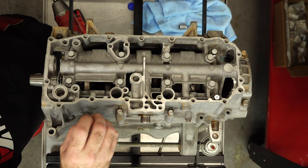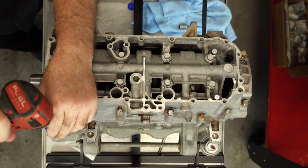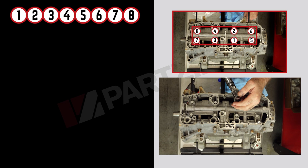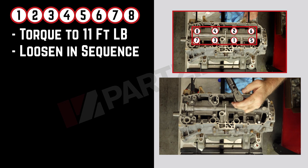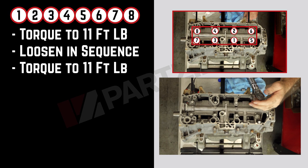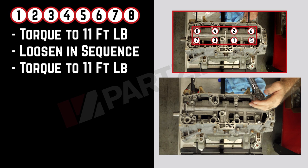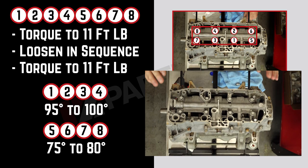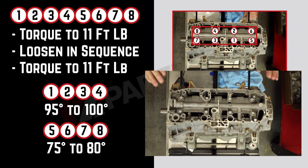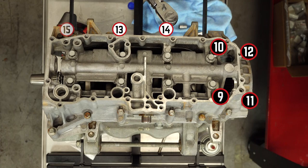23 is this one odd ball right there. So now all the bolts are in the right place — now we just need to go through the torque sequence. All right, the way we're going to do this: one through eight, you take each one of them down to 11 foot-pounds. Now we're going to go back, loosen them, take them back to 11 foot-pounds one at a time. Then one through four is going to go to between 95 and 100 degrees, and then five through eight goes between 75 and 80 degrees. Those were the most important ones, but now we just need to finish out the perimeter. Nine through 12, we're taking those to 17 foot-pounds. Now the rest of them, 13 through 24, is 8.7 foot-pounds. The rotation assembly is together and sealed up.